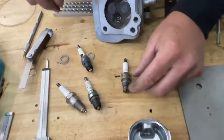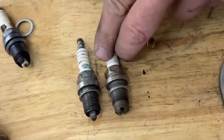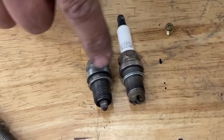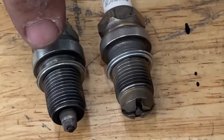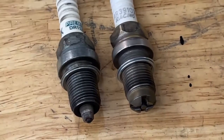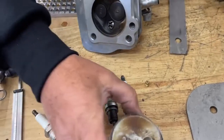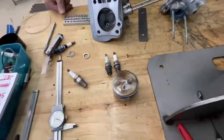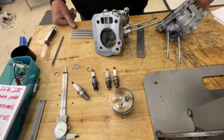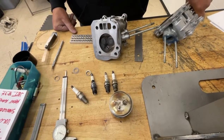The next thing is you just have to buy a bunch of spark plugs and look for the deepest one you can find. You can see there are different size washers — it's got to be a double-fold washer — the rules don't state how thick that washer has to be, so try and get that spark plug as deep in the hole as possible. Alright, that wraps up our spark plug video. Thanks for watching — give us a thumbs up from the home of Crybaby Performance, where we try and they cry.